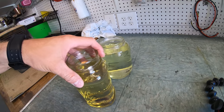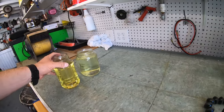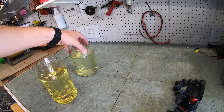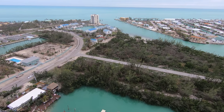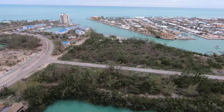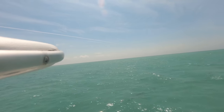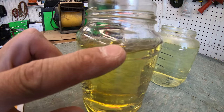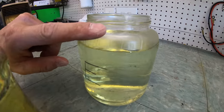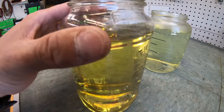Now what is going to happen next will also depend on the location where you are, because the humidity level of the air is going to play its own part in this experiment. Where we are in South Florida, we are at sea level and only a couple hundred yards from the open ocean, so we have a very high level of humidity. But the humidity level is always going to be elevated when you are on a boat in the middle of a body of water, even if that is on a lake in the middle of North Dakota. We will start to see the fuel turn a cloudy color, and what we are actually looking at is condensation developing on the sides of the jar because of temperature changes with the fuel, the air, and the jar.